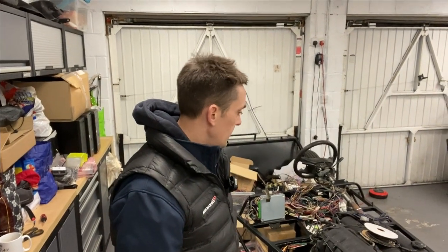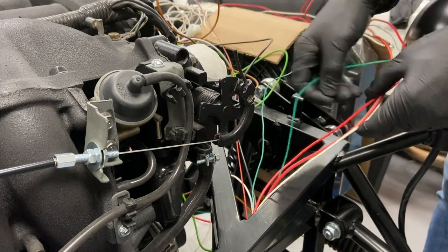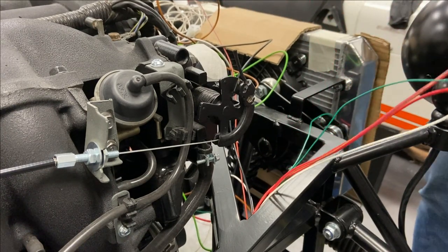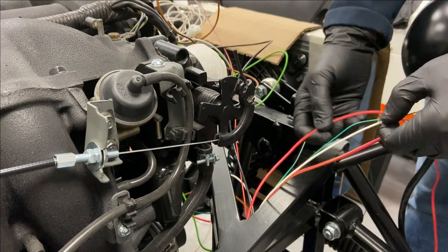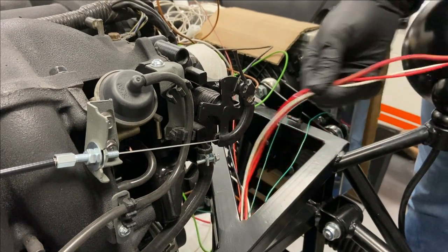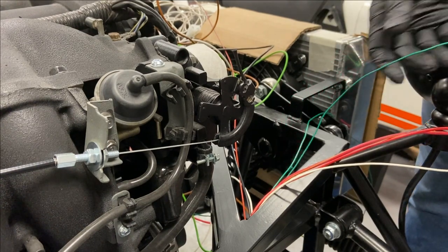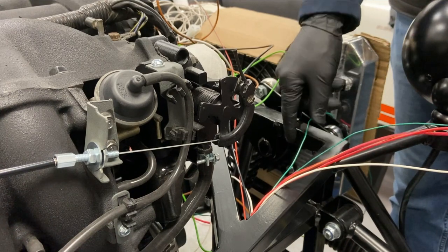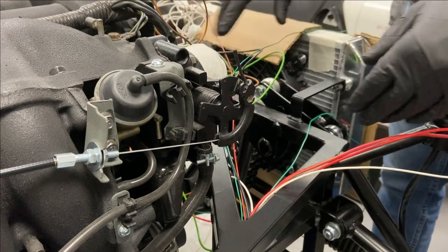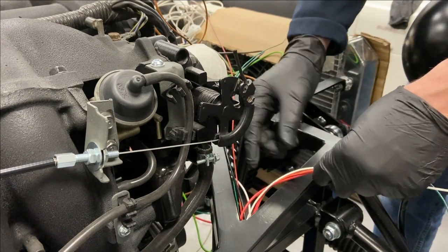What I'm going to do today is just finish off this front end. What we've been doing on the front end is we've got the headlight wires - there are three headlight wires. I'm on the driver's side, the UK driver's side. So I've got white, red, and red-yellow. Those are the three for the headlight. There's also green-black - green-black is left indicator, green-white is right. Green-black is going to go that way with the rest of this loom.